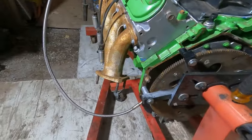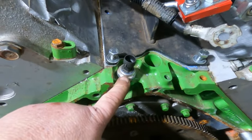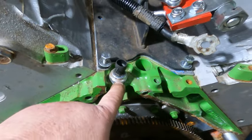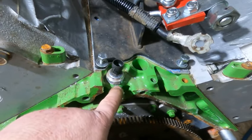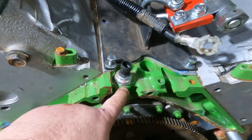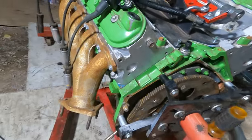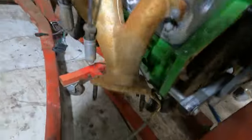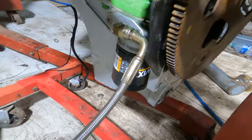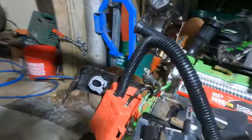Thankfully I used a lot of assembly lube when I put the motor together. I've primed this motor both through the oil pressure passage. I never put the filter screens back in — there's a filter screen that plugs up and causes the oil pressure gauges not to work in these motors, so I never put them back in. And this is the turbo oiling line that comes off the side of the pan here — I never got oil to come out of this line.